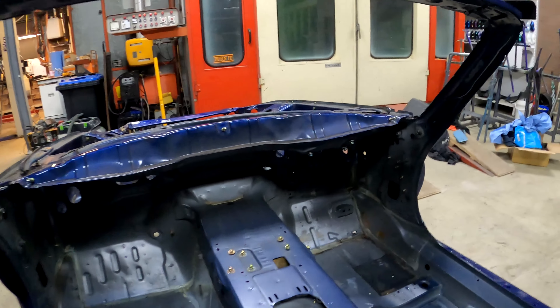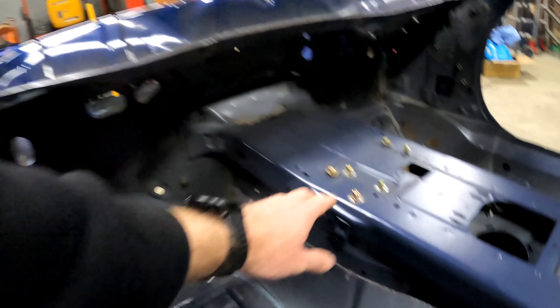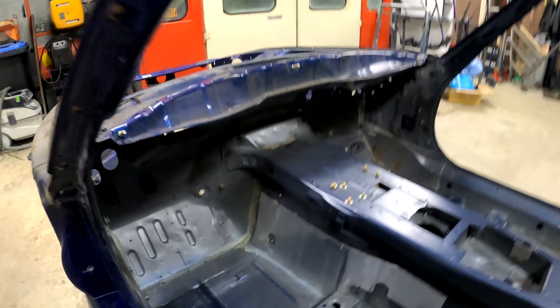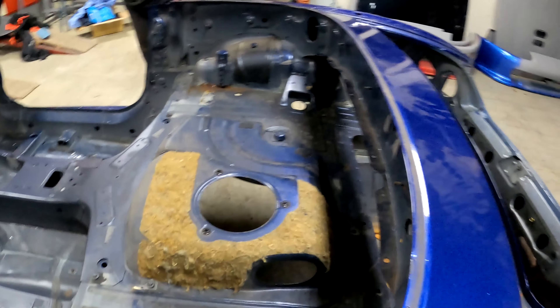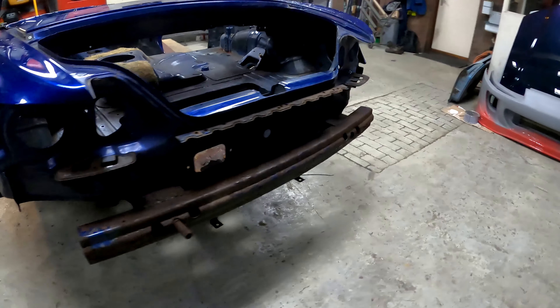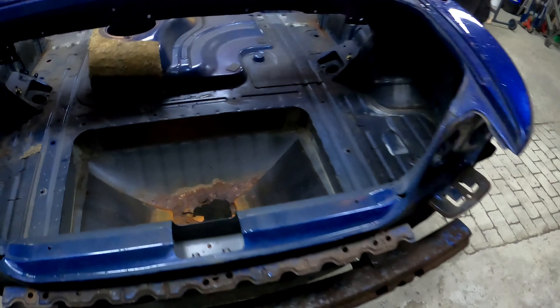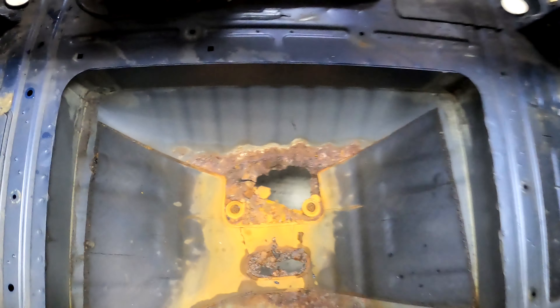You can have a look inside — it's completely cleaned out. The whole chassis is going to get sandblasted; all the little bolts and everything come out so the chassis is completely clean. The fuel tank's been removed — there was a full tank of gas in there, so we actually siphoned the gas from the tank into the Del Sol, so we've got a full tank to drive home on. No pipe, subframe gone, everything off the back at the bumper. There's a big hole in the chassis underneath where the boot connects to the fuel tank, so that's going to have to get fixed up.